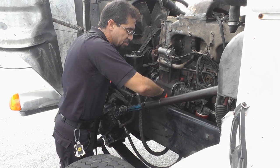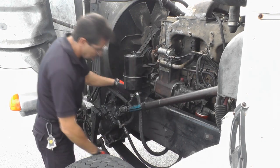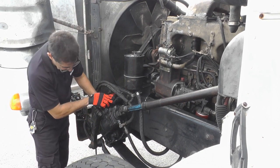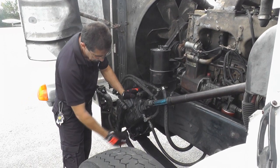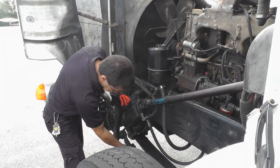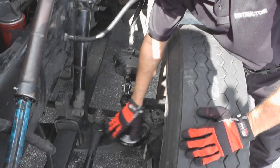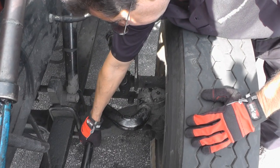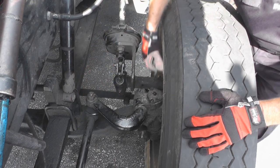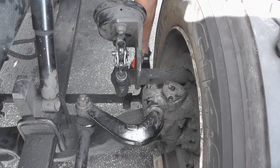I'm going to follow the hoses around to my power steering pump, making sure it's secured and there are no visible leaks. I'm going to check my power steering gearbox, making sure it's properly mounted, the bolts are there, not broken or missing, and there are no leaks. Checking my pitman arm and drag link — making sure there is no play, it's secure, and the crown nut and cotter pin are not missing. I'm going to check my steering knuckle, making sure it's properly secured, no play, and the crown nut and cotter pin are not missing. Checking my tie rod — properly secured, no play, and the crown nut and cotter pin are not missing.